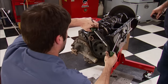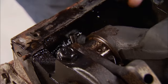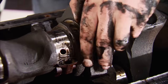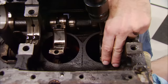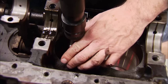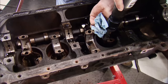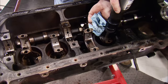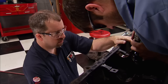We need to see if the factory forged crankshaft will come out without removing the rods. First, we'll remove all of the rod caps, followed by the massive mains — these share the same design and size from Chrysler's Hemi V8. On cylinders one and two, they came out relatively easy because the valves were closed on those cylinders, keeping the water out. As we progressed, so did the degree of difficulty, but it came out with a little vibratory persuasion. Number four was the most stubborn — the piston was rocking and our efforts weren't working.